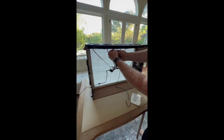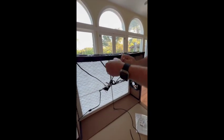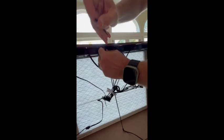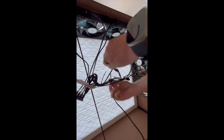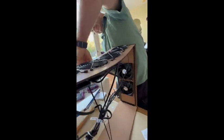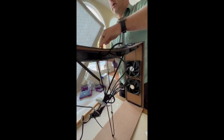One of the last steps is to put the tension cord through a back fan hole through its screw hole, then tie a single loop knot. We like to use the screw holes on the second and fourth fans to create a V shape. Thread the cord through one of the holes, pull it through, and make a single loop knot once you've created some tension. This will create a tight fit on the long axis against the filter edges.